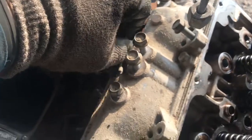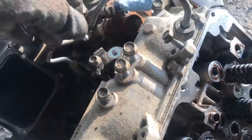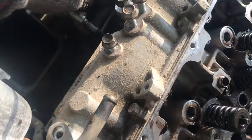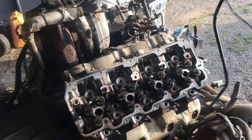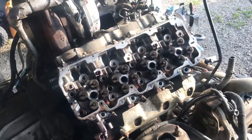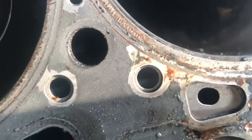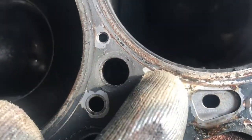Then it's ready to come off the head. I already wiggled it a little bit — a little bit of coolant coming out, so it's not fully drained, sitting here at a bit of an angle. Get that out of there, stick that bolt back in the hole. Ready to lift the head off — manifolds are still on, we'll take intake and exhaust manifolds off once it's off, and then have a look to see if we can see where the compression was passing. There's a line right here.